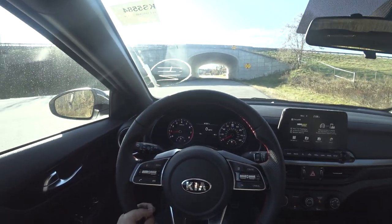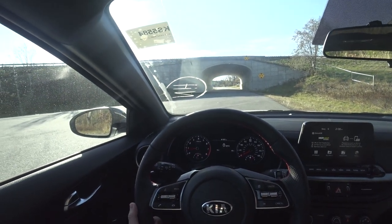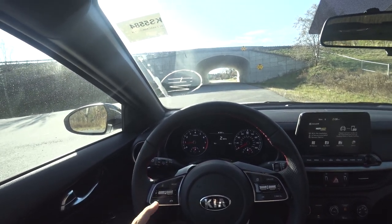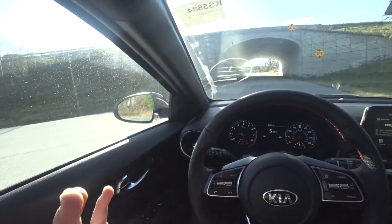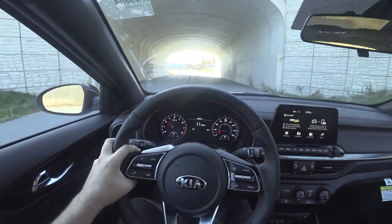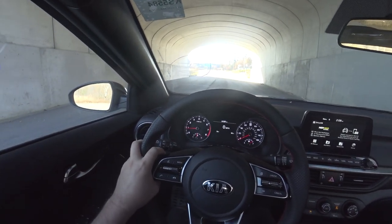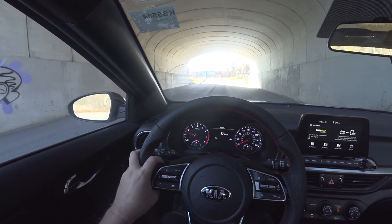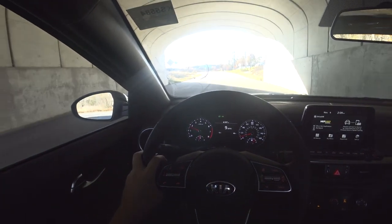Setting off with the beginner technique: slowly releasing the clutch, I'm at the engagement point, I stop my foot, and now I'm just lifting my toe. Once it's moving around five miles an hour, you can lift off the clutch. The second technique is a little more complicated, especially if you're on a hill, but you rev it to 1500 and do the same thing — keep it at 1500 until you're moving, and then you go.